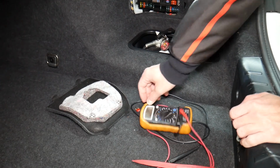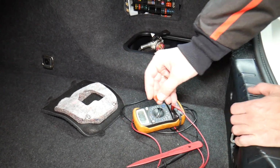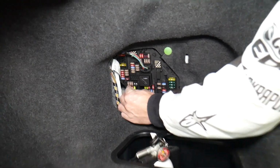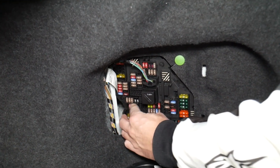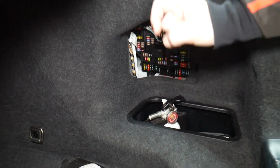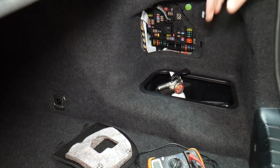So always test your fuses, even if you think it's good, always test it. It even happened to us guys, and we work on cars all the time. Another thing, always test your relays. They're a little bit harder to test, but if you want to see how to test fuse relays, we will put a link in the description of the video below.